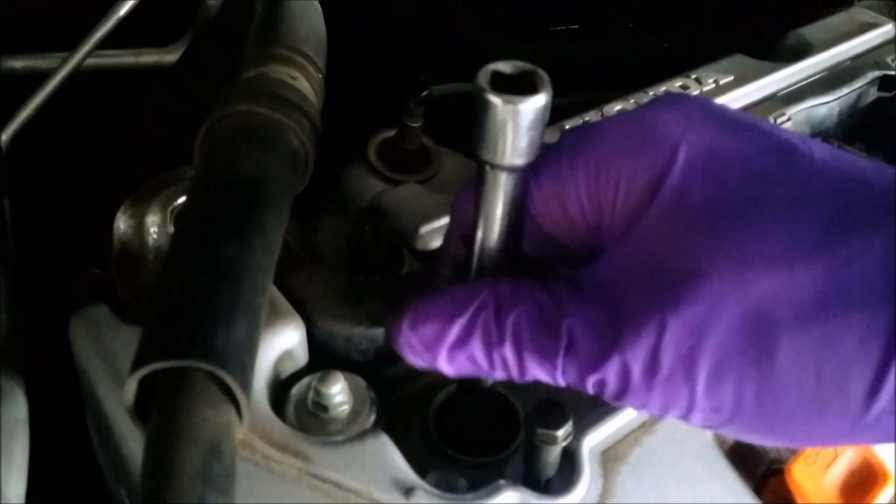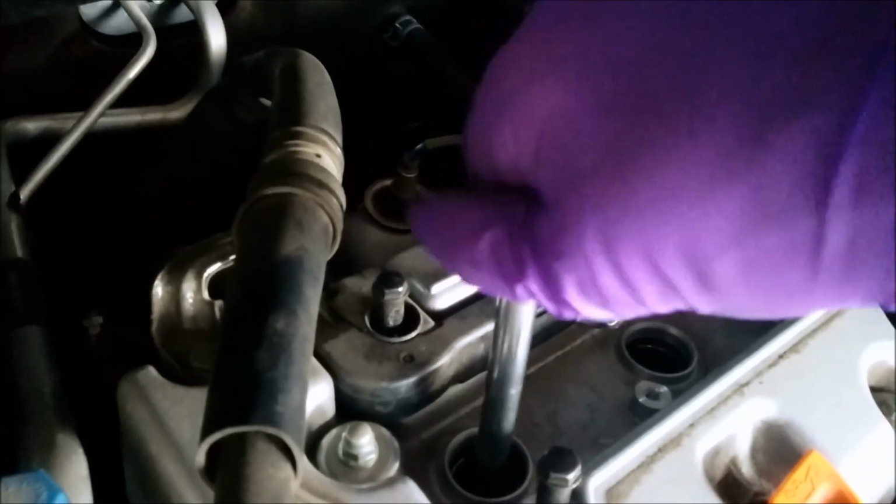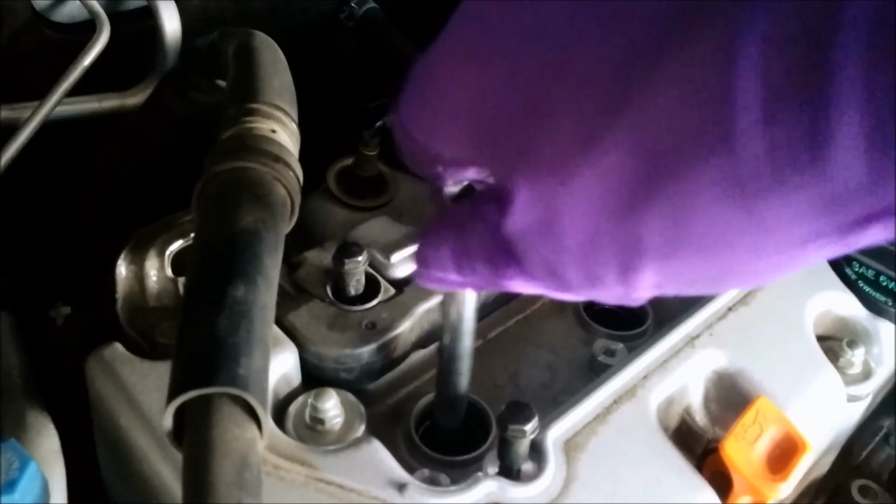We got our dielectric grease and we got our anti-seize. We come on over and we make sure we get that in there with no problem. And the idea of tightening here is you just want it barely, because it has anti-seize lubricant. There's not going to be as much resistance as if you didn't have a lubricant. So you want to barely tighten it.